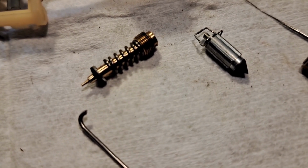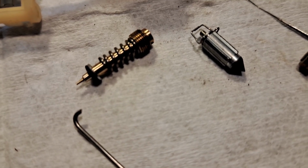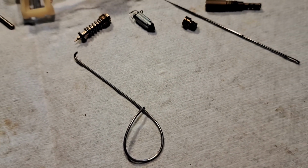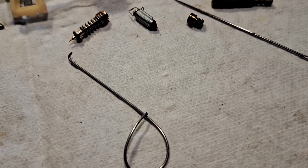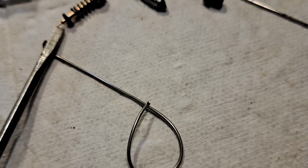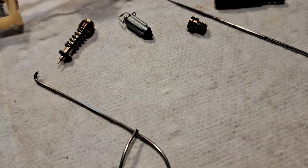So typically the screw comes out by itself and it leaves the spring, the washer, and the O-ring in place, and you make yourself a little tool or something. You know, a little piece of wire with a little hook on the end. You can draw that out with. Make sure you don't fumble that. A lot of those washers and O-rings have been fumbled, and it's possible that I may have done that myself.